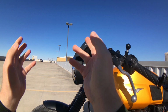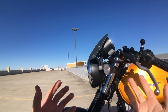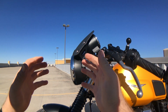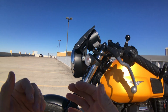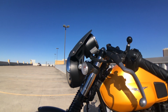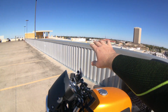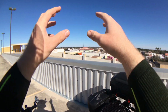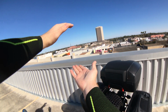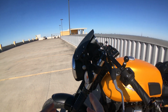And so once I got to that stage, I took the bike out for a ride, was out on the highway, and damn, voila, it's actually working. I still had the protection on my upper body, but my airflow towards my helmet was much smoother at that point in time. And as I rode around and tested things out, I realized that my turbulent air had shifted from my helmet down towards my shoulders, and the width of the turbulent air, like I said, about 12 inches, went down to roughly maybe 6 or so. But it still wasn't optimal.